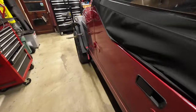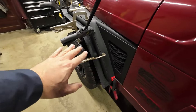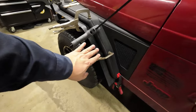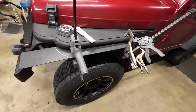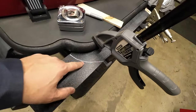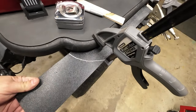I got this out to two inches, which is what I had before with the rubber. I'm probably going to have to heat this up to get it to bend up tight like it needs to be. I took the heat gun and warmed up that plastic. I clamped it so it would take the shape of the steel fender. I'm going to let it cool for a few minutes, then take the clamps off. This is my cut line — I left it a little bit long, but let's see if I can make it work.